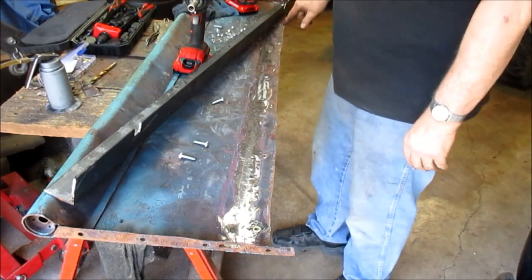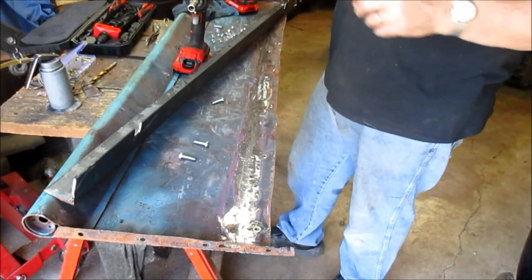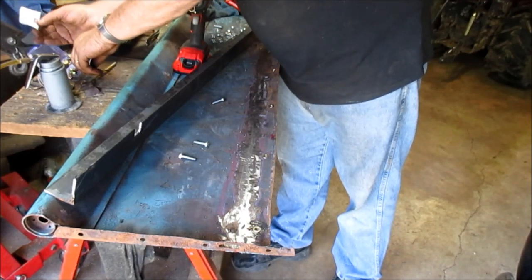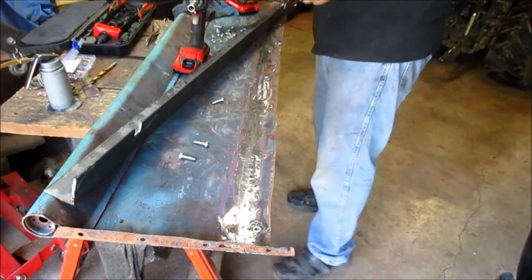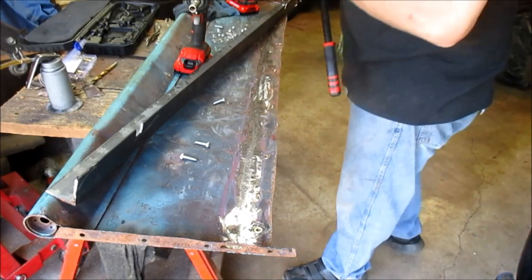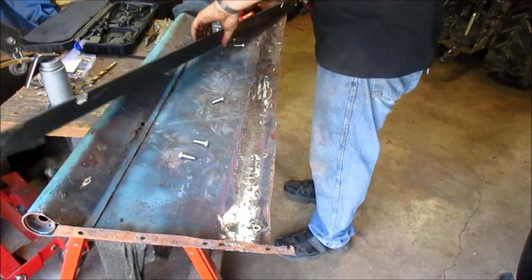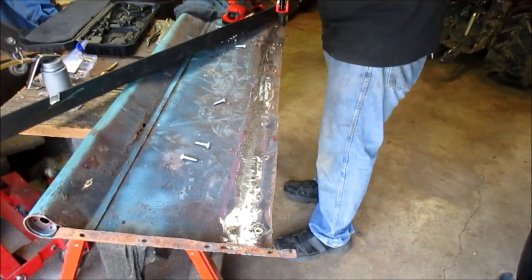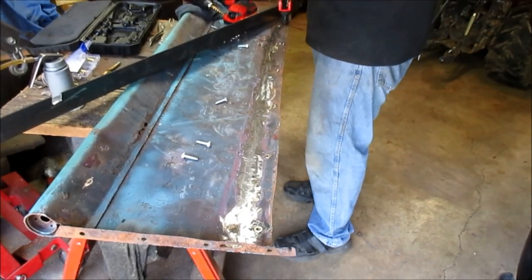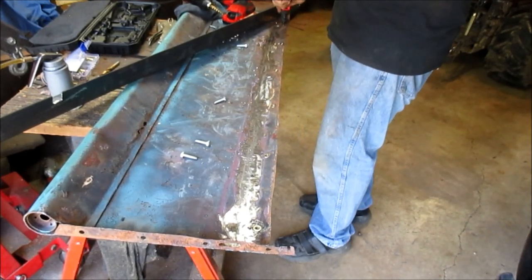The reason I'm having to drill them out is because I drilled only quarter inch holes, and these quarter inch inserts need, what did I read there? It was a 23/64 minimum. When I did my markings, I could be off a little bit, so that's why I'm checking as I'm going. Once I do the first crimp, I like to spin it four more times to get that final crimp in there.